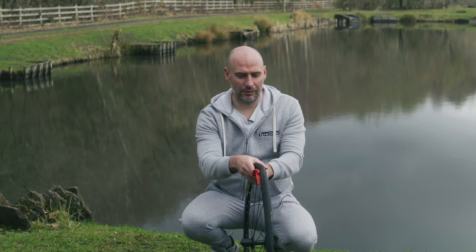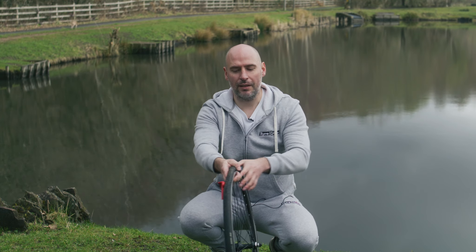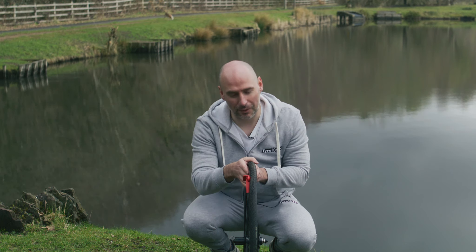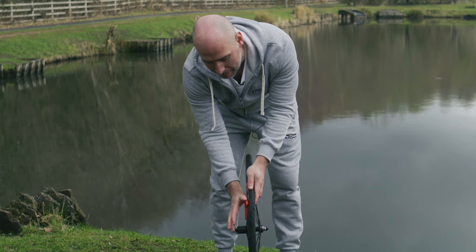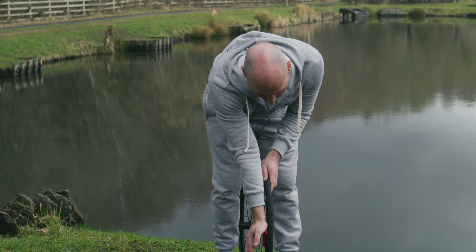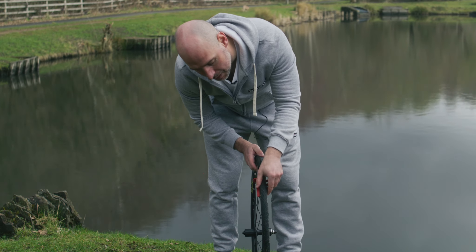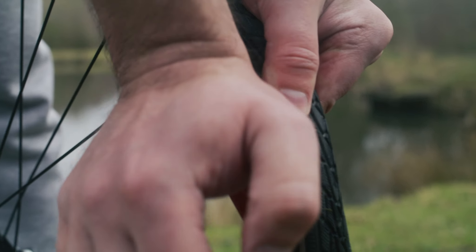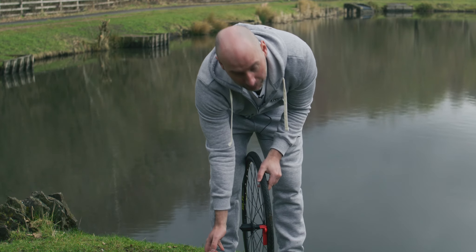Now I'm at this position — as I'll show you, we're starting to get tight on the rim. Again, I designed the Tire Glider's shape for this reason. I can stand up a little bit, put my palm on the flat edge, and start pushing down. Once it gets a little bit tighter, what I normally do is take my left thumb and just ease the tire over.